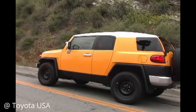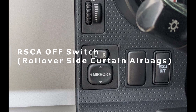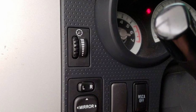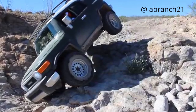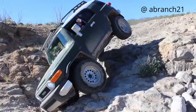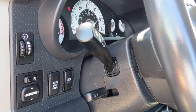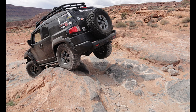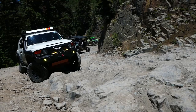Another switch added in 2009 and on was the RSCA switch, which stands for rollover side curtain airbags. This button was located to the left of the steering wheel in the right button slot, and is intended to be pressed when you plan on off-roading and getting into off-camber situations. The FJs for 2009 and newer were designed so that at a certain angle of off-camber tilt, the airbags would automatically deploy, like in the case of a slow-speed rollover, versus being triggered by a harsh impact. This button, when pressed, disables the side curtain airbags, so if you off-road and happen to get tilted at a pretty good angle, your airbags won't accidentally deploy. Be sure to engage this feature when off-roading any time you turn on your FJ, to avoid having side curtain airbags deploy unnecessarily.